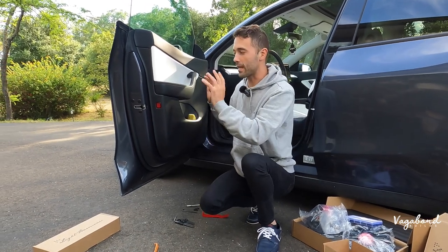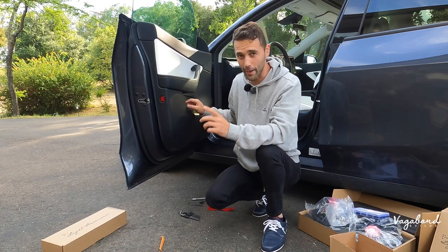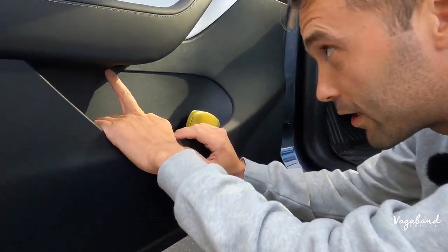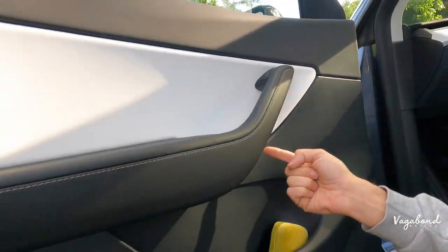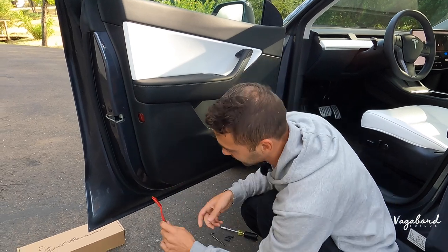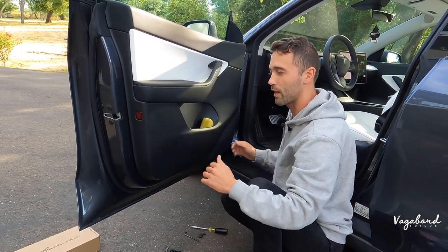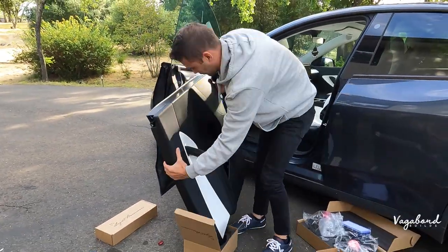A quick tutorial of how to take the door panel off and replace the door speaker. This video will be more focused on the door speaker Generation 2 Light Harmonic. There are three places you have to remove some Torx 30 screws — right behind this little red reflector here, under your armrest, and right here on top near the door switch. Remove those Torx 30s and we're going to go ahead and pop this panel off the door. Slide this plastic panel remover — don't use metal because you don't want to scratch your paint.